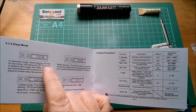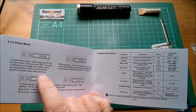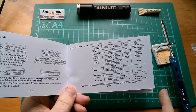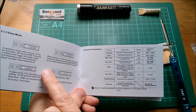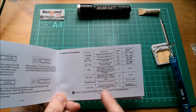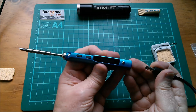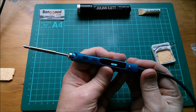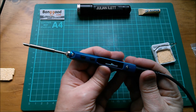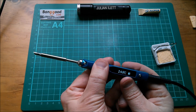When leaving it for more than 180 seconds — three minutes — it will trigger sleep mode and the temperature will automatically adjust to the preset sleep temperature. Because it warms up extremely quickly, maybe I want to shorten that three minutes to less than one minute. To adjust these parameters I could also pull the power and put it back on to enter sleep mode, but more manual reading is required.